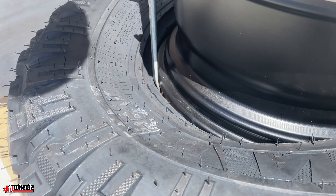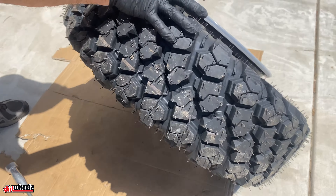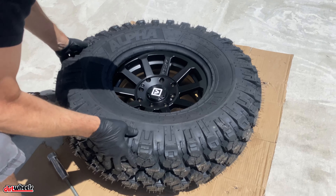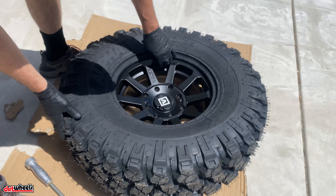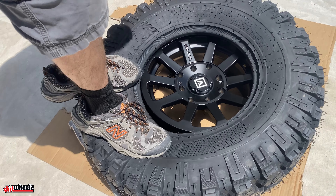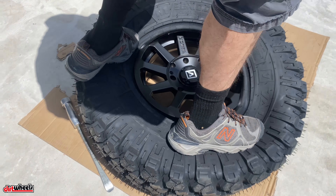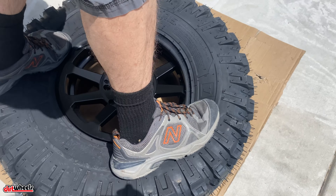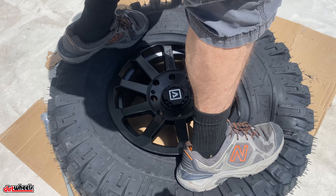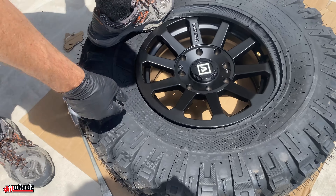Now I'm going to flip the tire over — this again will protect the wheel. The back side doesn't really matter but some people are particular about scratches. Now time to seat the second side of the tire: push that bead into that groove in the wheel again. That indentation — the further in you can get it, the less spooning you'll need to do.